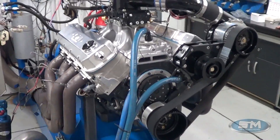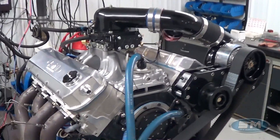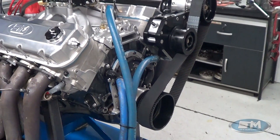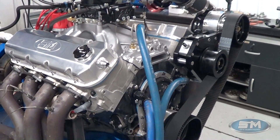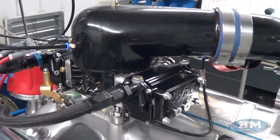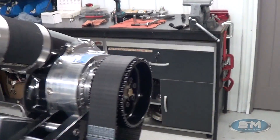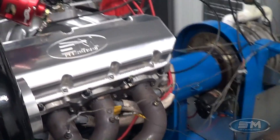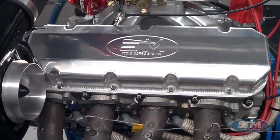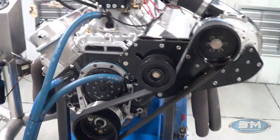It was an engine that he already had, and he just had some problems with it, so he brought it to us. This is a 540 cubic inch Dart block, and he had some Dart Pro 1 345 heads ported. It's a non-intercooled blow-through. That's a Carb Shop carb and an F2 unmodified, so a stock one. Primary usage for this is a street car — a little bit of strip, but mostly street. Going out and beating on it and whatnot.